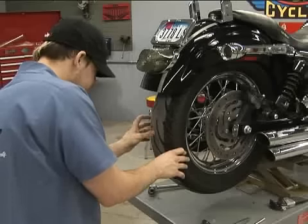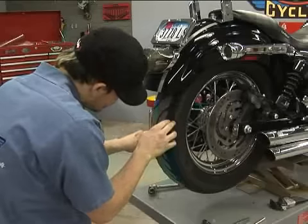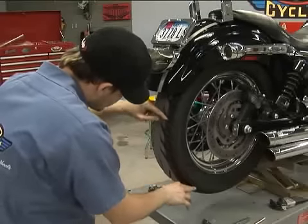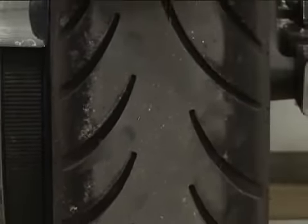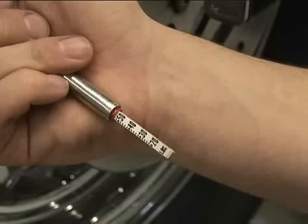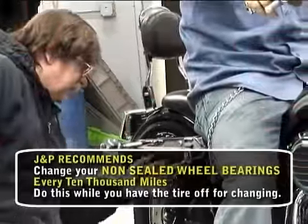Number four: your tires. Take a close look at the tires. Check the tread for nails or screws, and list the aid of a buddy to roll the bike as you inspect the tire tread. The tire's tread should have at least 3/32nds of an inch depth at the thinnest part. Most tires have safety bars incorporated into the tread pattern — as the tire wears down, the safety bar will cause the tread pattern to appear smooth all the way across in a swath about two inches wide. Besides checking the usual tread wear and sidewall cracking, make sure you check your service manual for the proper air pressure and wear limits. And did you install anything new that might affect clearance? It may look right just sitting there, but have someone check when the bike is loaded with you, your passenger, and your luggage.